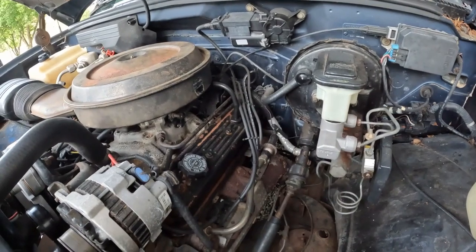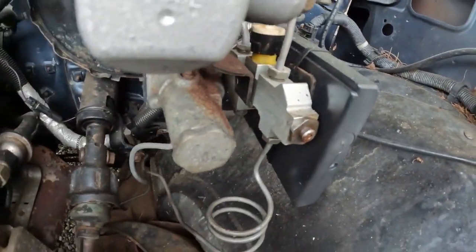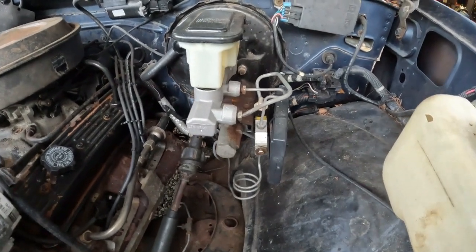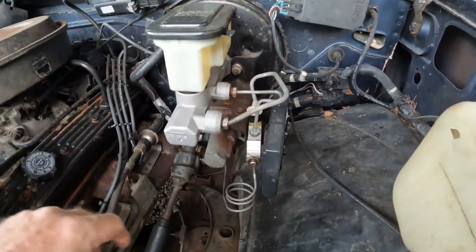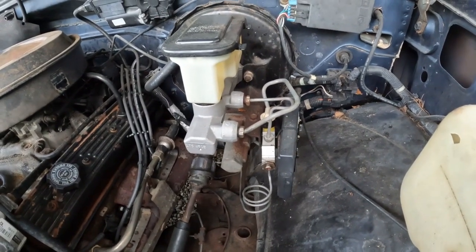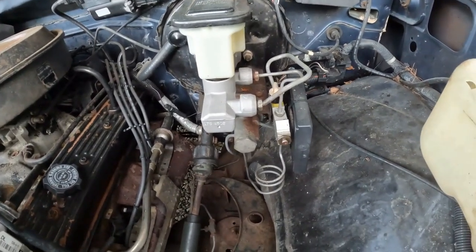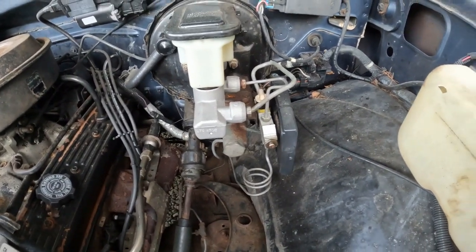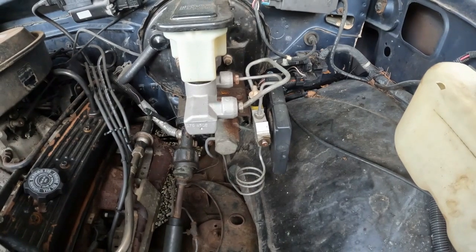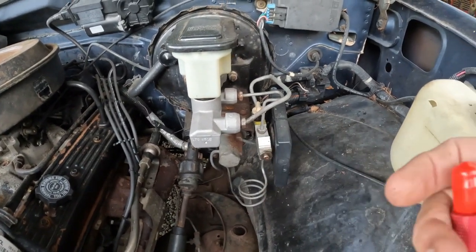While this truck's been parked for several years, we've been trying to get the brakes to go on it. We've replaced everything except this proportioning valve here. The brake line burst on the back when we were moving it around. What that usually causes is this proportioning valve to shift to one side. It doesn't look like it's pushed out, but it'll favor the front brakes and block off the rear brakes because that's where the line busted, in order to preserve the brake fluid and make you still have some brake pressure. I think it's not reset — I think it's moved.